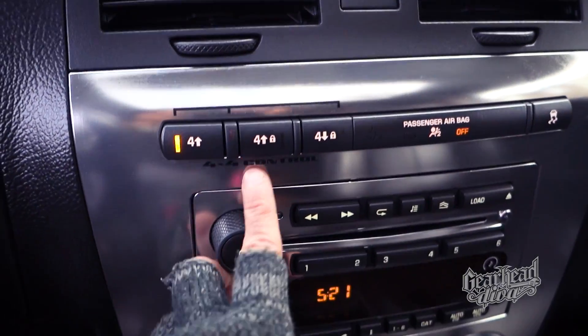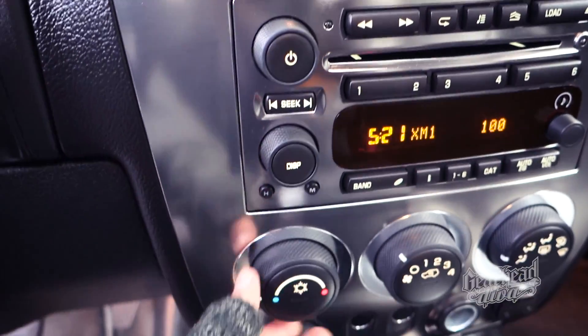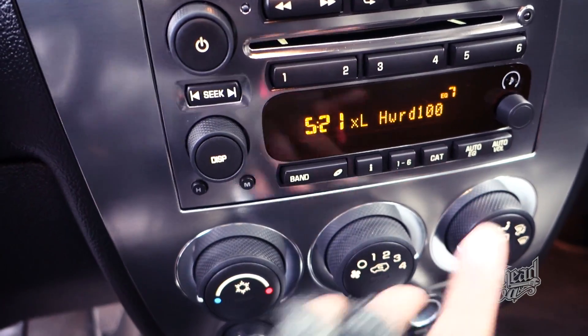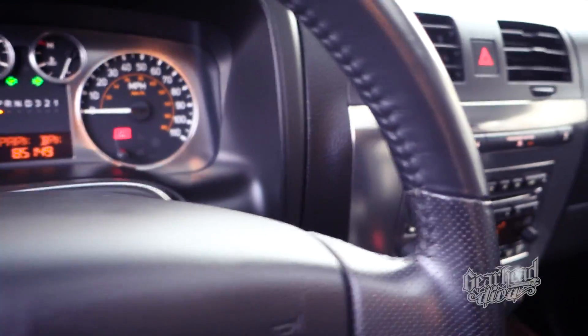For test number two, this is the load test. I'm going to hop in and turn on everything I can think of — the radio, the air conditioning, the blinkers, the headlights, everything but the rear defroster. If you have an off-road vehicle, pop on all that exterior lighting as well. When we take our reading, we want at minimum a 0.5 volt reading above our initial battery charge. Since our initial charge was 12.5 volts, we want something at minimum in the 13-volt range.